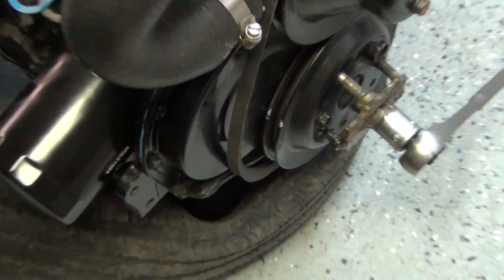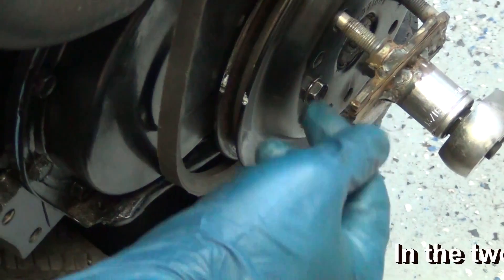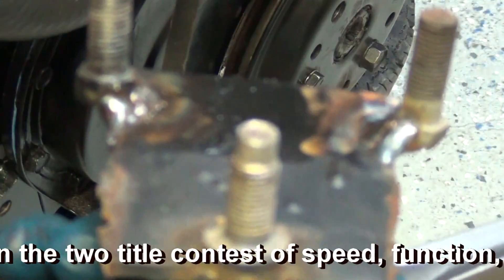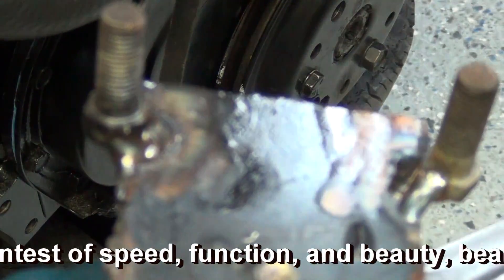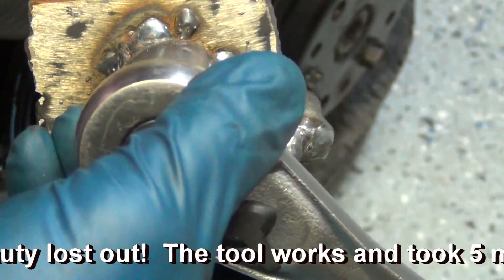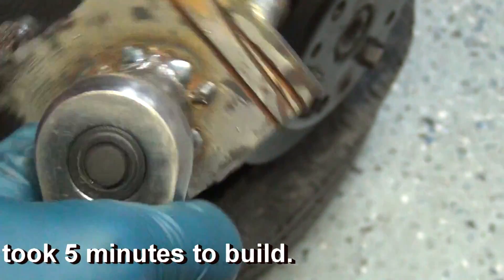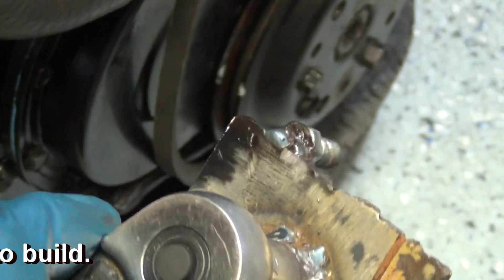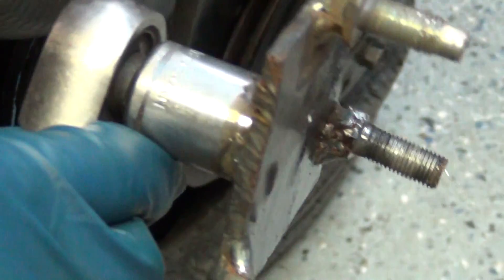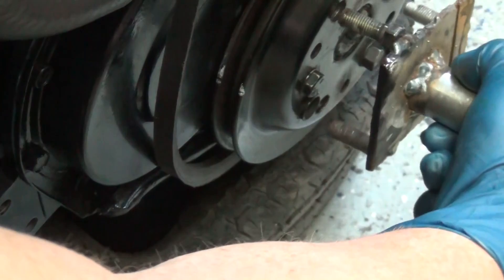I had to make a special tool to be able to rotate this because there's no nut on the end — the pulley is actually pressed onto the crankshaft. So what I did is I took some bolts and a piece of scrap metal, ground the bolt heads and the metal so it would work, and made my own tool. I took a 20mm socket — which we never use for anything — so I bought a bunch of those for making crafts like this. Arts and crafts, that's what this is.